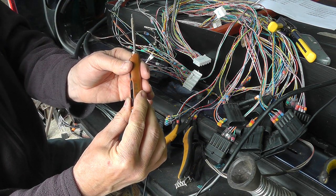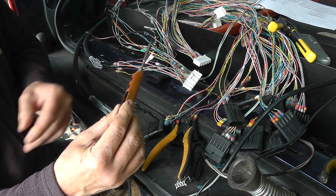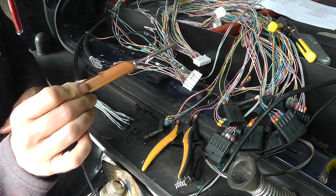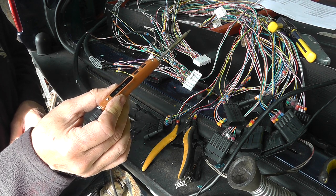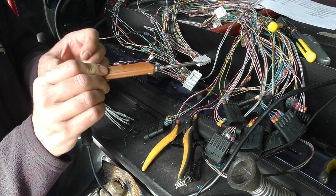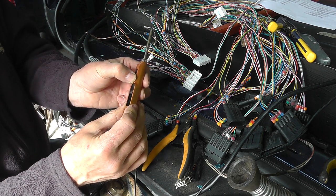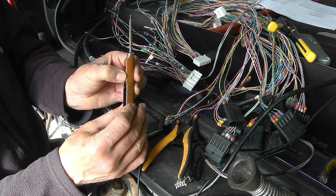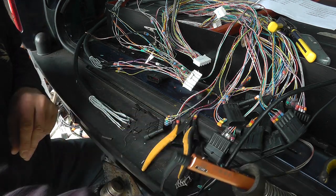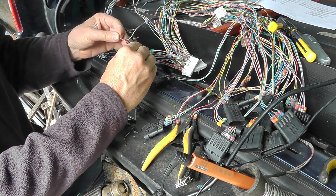Here we're using my trusty TS100 soldering iron, which is a fantastic soldering iron, and I'll put a link in the description where you can get these. These are amazing things. They will either run off 12 volts, from 12 volts to 24 volts I think, maybe up to 30, I'm not sure the exact top voltage, but I think I'm running this currently at 19 volts. So obviously the higher the voltage, the more power you get. I'll bump it up to 400 degrees C because that's what I need for what I'm doing here. So put that in there.